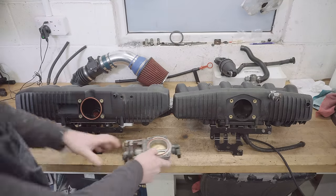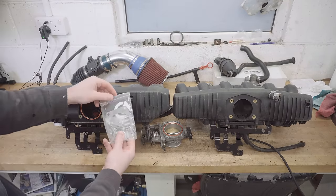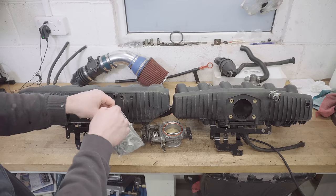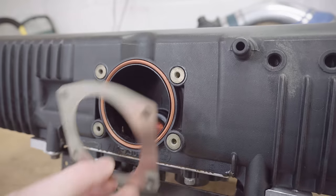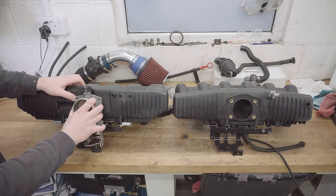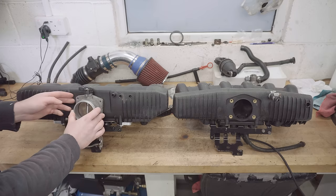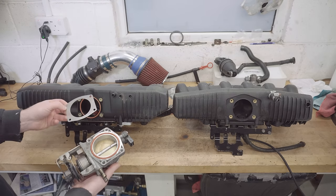To get around that, I got a kit from Creation Motorsport, which again I'll link in the description, and we're going to use this large plate to sandwich between the two seals, and that should mean we get a good seal. We'll fit this plate and the throttle body in situ, because until then they'll only get in the way really.